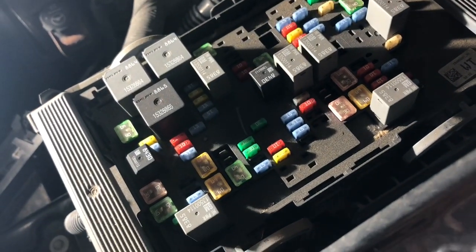I've already set up a lamp here to be able to take a look. That's your fuse box there. Now to unlock it, you have to pull out of this — actually, that was pretty simple. You pull out and pull up, and this whole thing should just come out. There are your fuses. Now how do you figure out what's what? That's on the back of this box — this is your cover. Flip it around and it'll show you where everything's at.